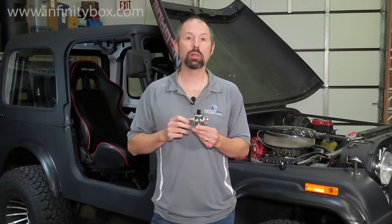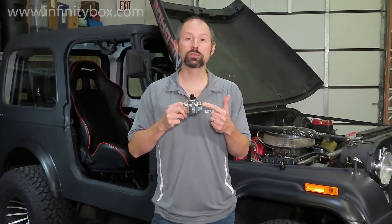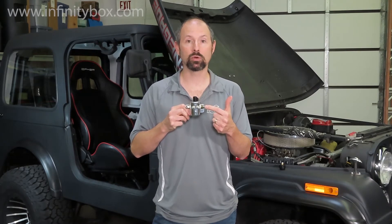The solenoid that comes with the in-reserve kit goes between the positive terminal of your battery and the block of mega fuses that distribute the power to your front and rear power cell. Primary power from the battery, or from B plus, goes in here and this goes to the bus bar on your mega fuse holder.